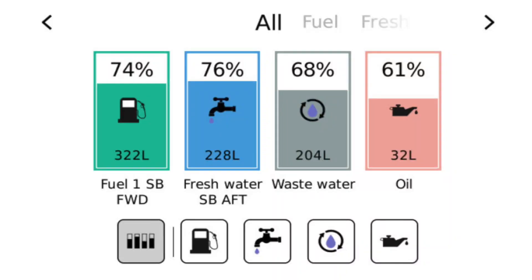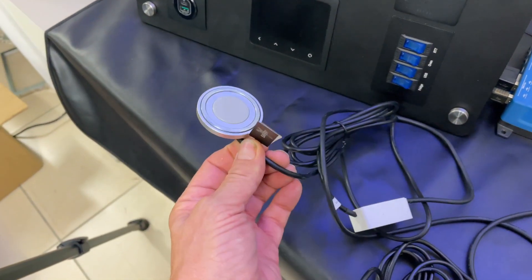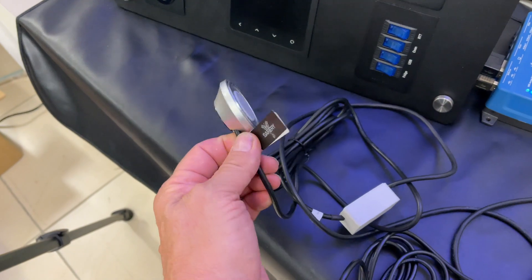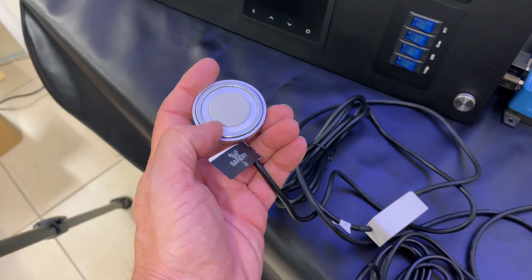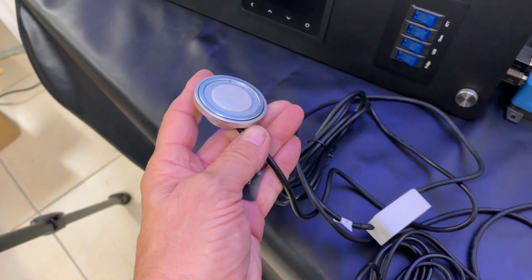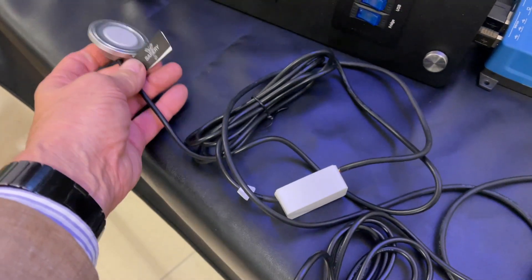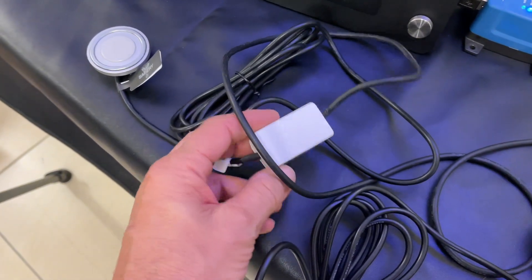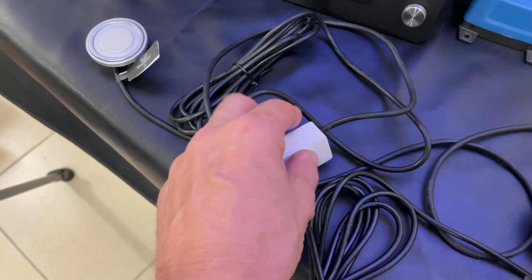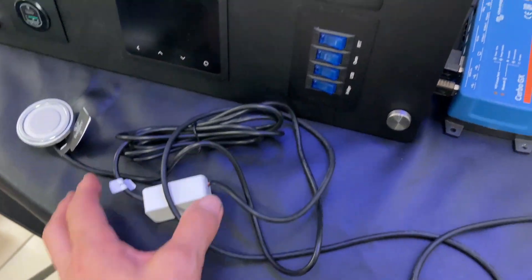Let's have a look at a couple of these sensors. This one here is for the LPG bottle — it's an ultrasonic underneath, but it's got a magnetic ring with an embedded rare earth magnet that comes up underneath the bottle. We have to go through a pre-processor here that converts the signal into 0 to 5 volt. That's the LPG tank sender.